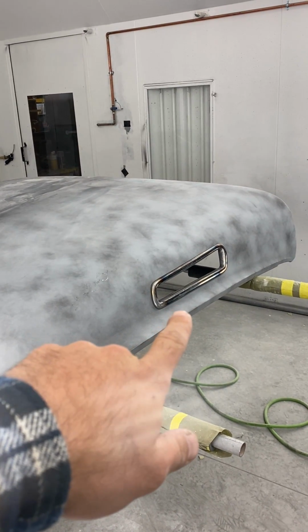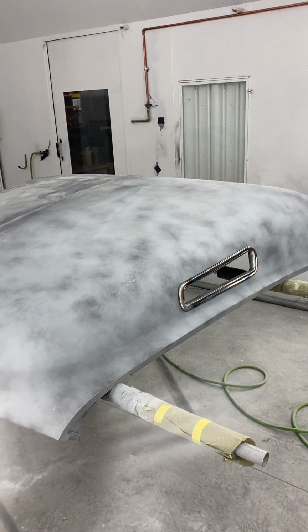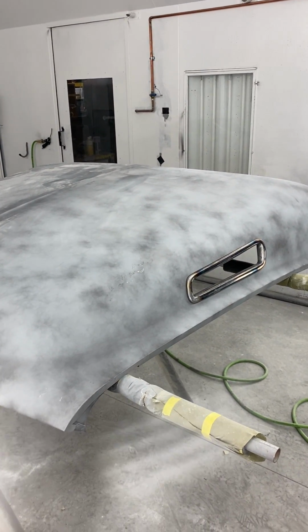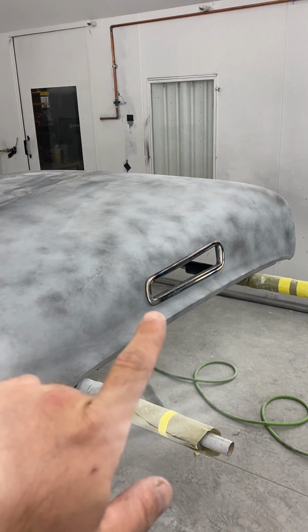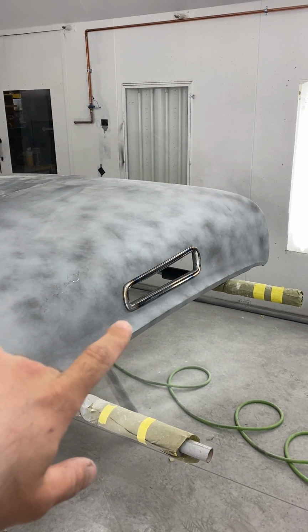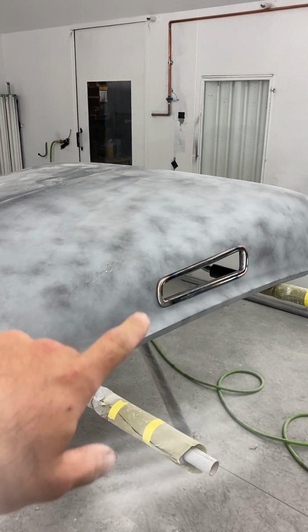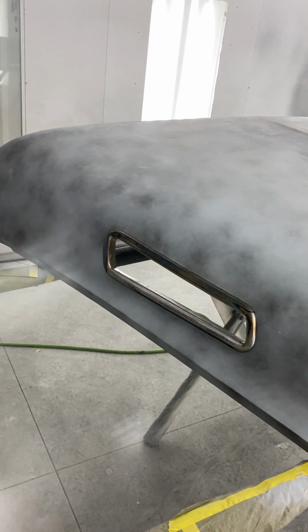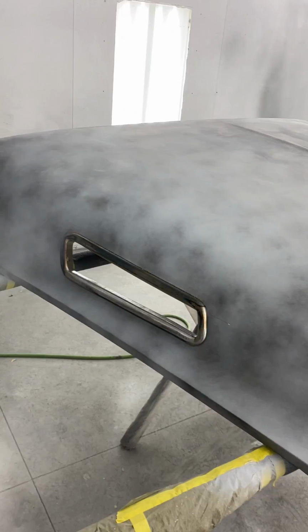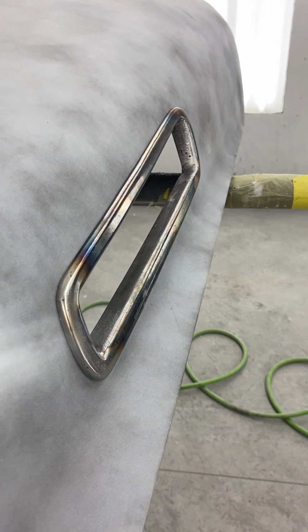So what we are doing is cut 2 holes, one in each side, and that is for our air intake system for that Coyote. So it's going to be a dual air intake with custom trim. For that trim, all we did was use 1-inch thick wall tubing and cut it, shape it, weld it, cut it, shape it, weld it, file it, and so on. Keep going until it's perfect. And we send it off to get chromed. And that's how you make custom trim.